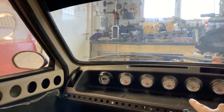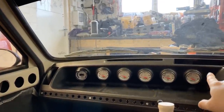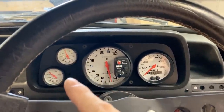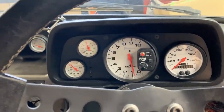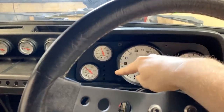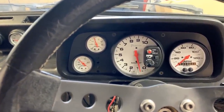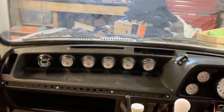I probably won't bother with the oil temp gauge, but the AFR, fuel level — hopefully that works with the standard sender in the tank. Oil pressure is the important one, water temperature with the sender in the thermostat. I've got the old monster tacho mounted in the middle, speedo, and two boost gauges. The little one will do between the big turbo and the little turbo, and that one will do the pressure actually inside the plenum. I need to mount my little LED lights — one for indicators, high beam, low beam, and a couple for oil pressure and the alternator light. Zach calls it the Millennium Falcon dash because it's got all the gauges.